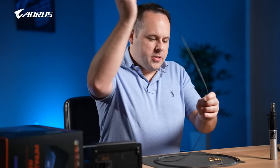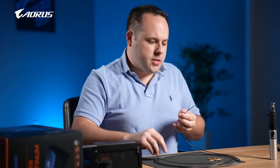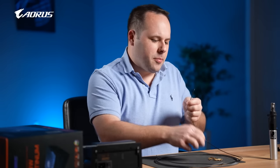Generally, in small form-factor PCs, you may want to use 18-gauge just because it's more flexible, whereas 16-gauge is going to give you a much stiffer cable. It's going to be hard to manage.